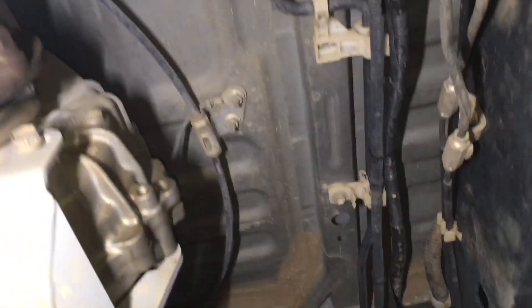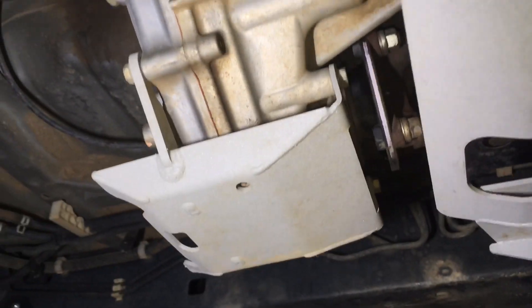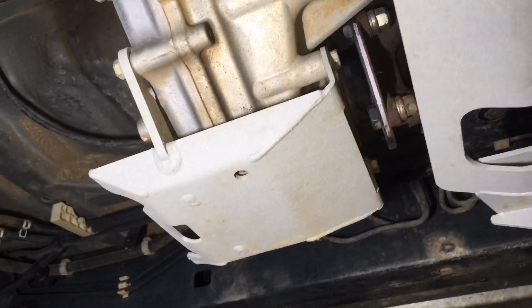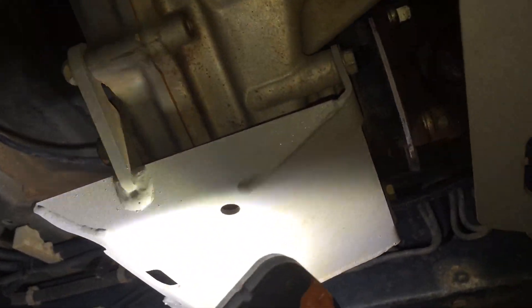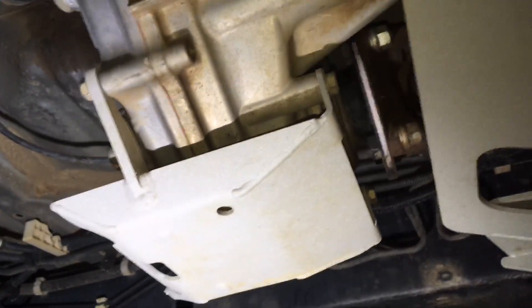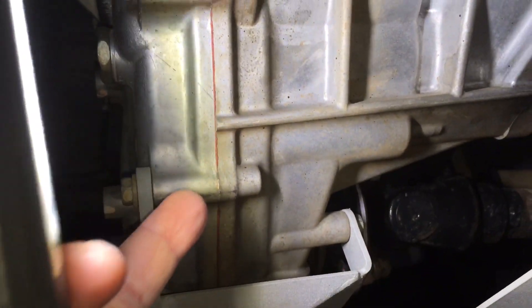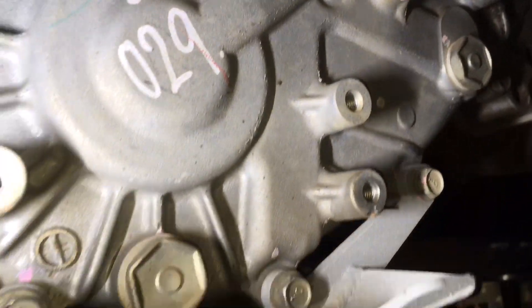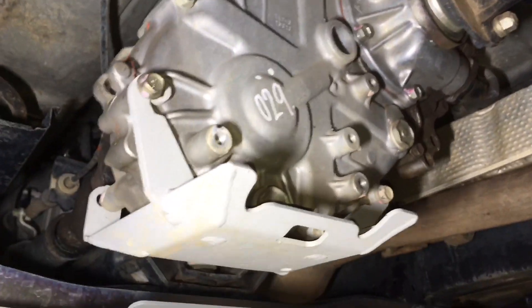Not a big fan of the strong aftermarket transfer case guard like that. On the Hilux they've got a longer wheelbase, so rocks hit these transfer cases a bit more — where on the Prados it doesn't. Now if you hit a big rock on there, there's a good chance it's going to break the alloy, because you've got big thick steel bolted into alloy that isn't that strong. I would prefer the original guard because as I explained in other videos, it's a thin piece of steel — it'll bend and mould to the shape of the alloy rather than snap the alloy.